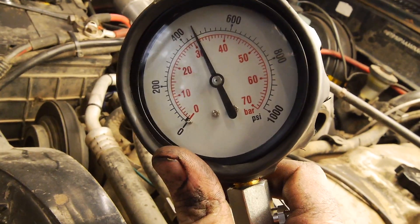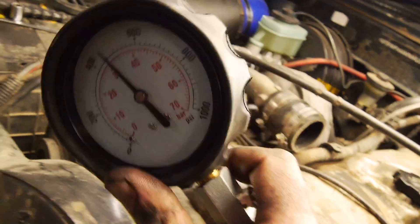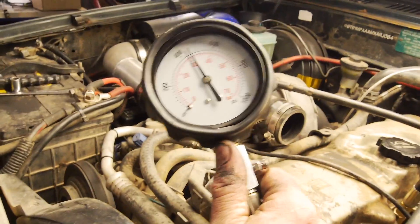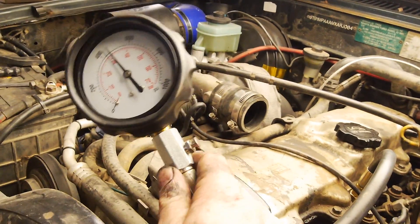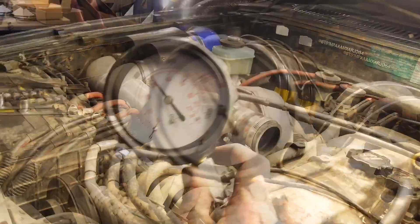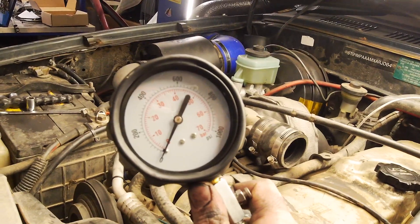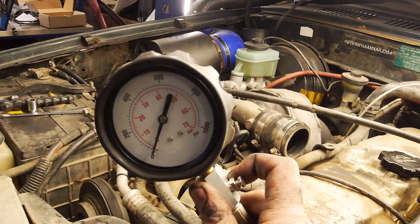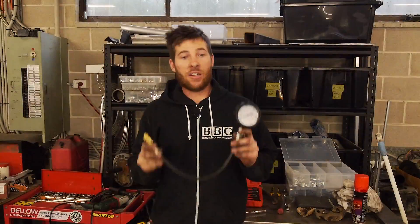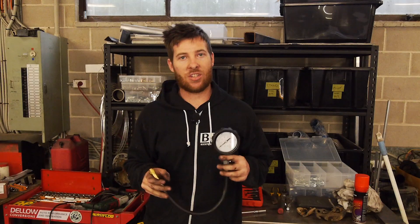And here we are — just like that. We are showing about 460 PSI on cylinder number two, which is probably about right for what I just tested. It's got a one-way valve in here which is actuated by this little relief valve, so it will hold your highest pressure. Once you've done it once, release it out, do it another two times, and that cylinder should give you a good average — you'll be able to get a decent idea of the engine's health. That's literally all there is to it. A $50–$60 kit from eBay and you're good to go with compression testing your engine.